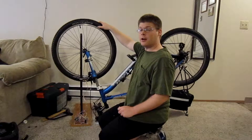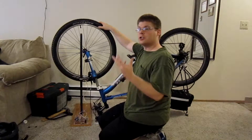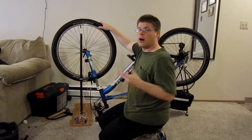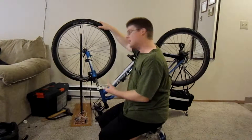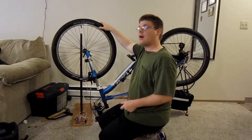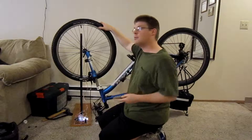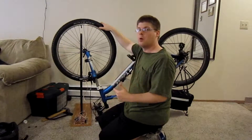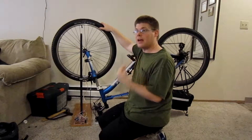Right here the wheel is a little bit out of true — about five percent, which is extremely low, not very far out of true, but it is still a little bit out of true. The sensor says that it's a little bit too far away. As a mechanic working on a bike, I can take my spoke wrench and adjust these spokes to move that wheel a little bit closer to the sensor, which should put it back into true.